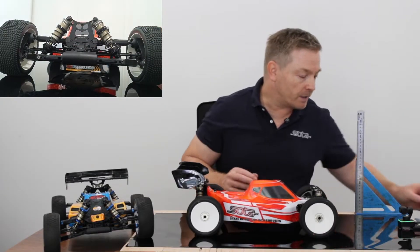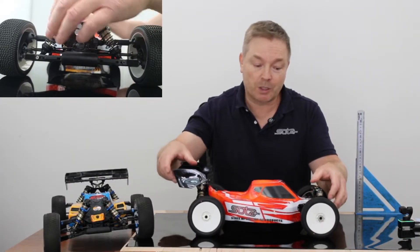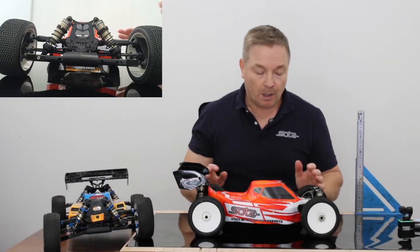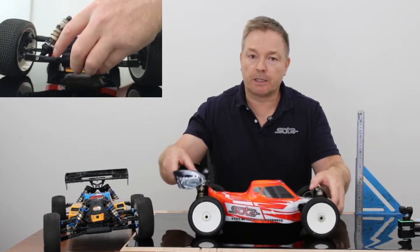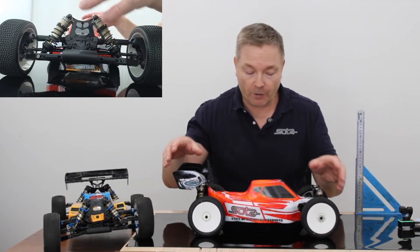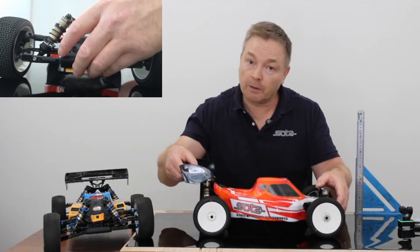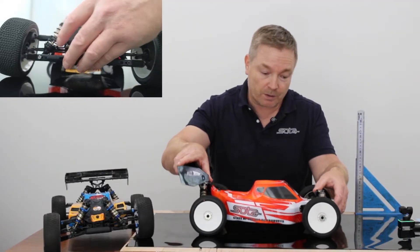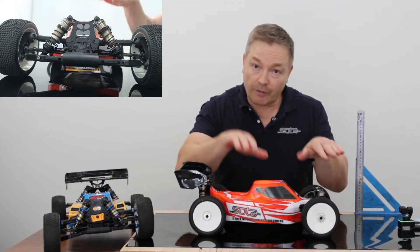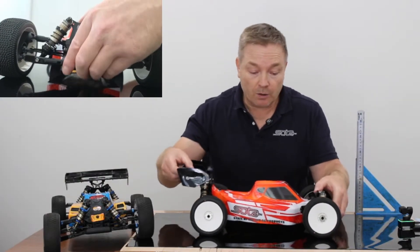What position-sensitive means is that you can have a nice supple ride in the ride zone where you can absorb the bumps and get more roll through the corners, which gets you more grip. Looking at a traditional handling table — typically a softer setup gives you more grip, but if you increase spring or damping rates you get less grip at higher speeds. Here we can now get more of both. We allow for that supple feel in the middle for bumps and low-speed grip, but as you roll more into the top-out or bottom-out zones, you get a completely different, firmer ride quality.